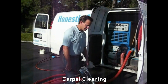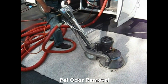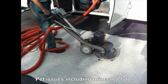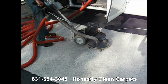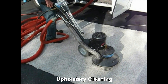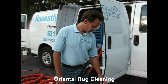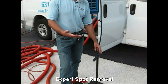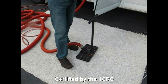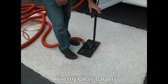The RX20 is another machine used in the extraction stage. This heavy-duty machine is excellent for getting soil out of carpets. This machine is called a water claw. It is used in situations where there is some kind of water situation or flood where the carpet padding itself gets flooded. Another situation where it is used is odor control problems — if a pet will urinate on the carpet, one can saturate the area with various agents that can kill and neutralize the urine, and then use the water claw to extract it out.